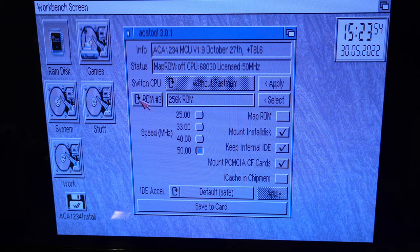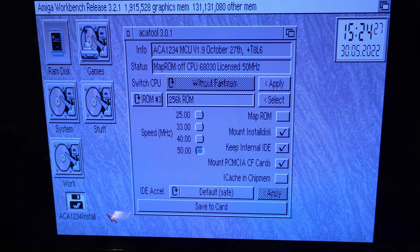Now the header, remember I mentioned before, the one that was disabled, that will put it back to its default. You need to do it if you do this, because when I boot to 1.3, when I save this, it's going to boot using the 1.3 ROM. Unfortunately, this utility isn't Kickstart 1.3 compatible, so it doesn't launch, it just gives an error. So there's no way for me to get back to other ROMs. It won't even use my onboard one. I pretty much have to unplug the card, but that's going to be useless because I still need to change the settings on the card. So what you have to do is use that jumper. It puts it back to its default. It will boot off of this, and then you can run this tool and fix it back to the way it was. Anyway, kind of went off on a side road on that one, but I apologize.